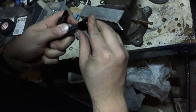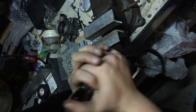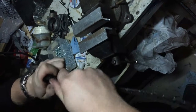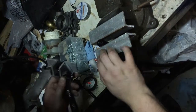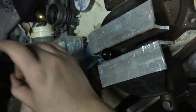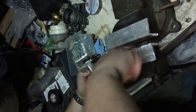First you're going to see me drop it — there we go. I'm attempting to push it in by hand, but it's really going to be easier just to put it in the vise. Now I've mounted the cap inside the vise and had a much easier time getting the hose properly seated, so it's ready to install. I've cut some more angle brackets to put around my crescent wrench to try to avoid scratching the AN fittings, but that ended up being mostly a waste of time.